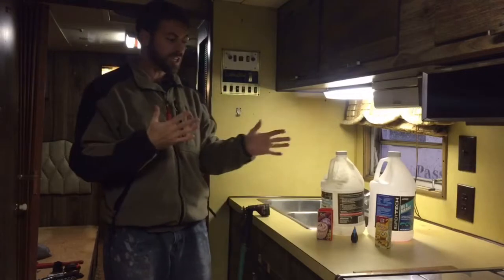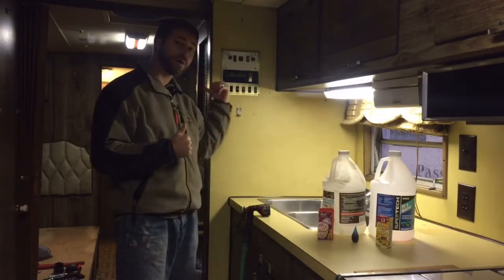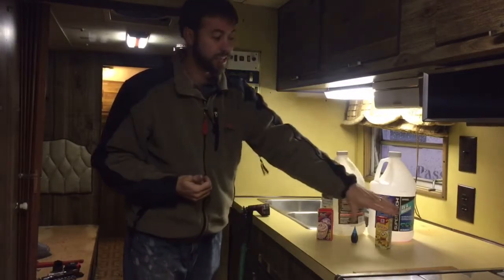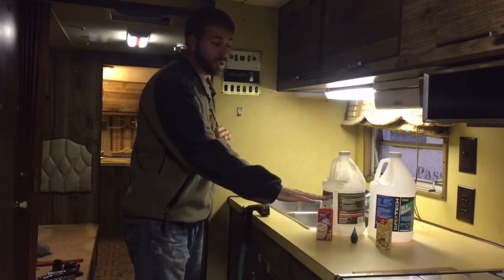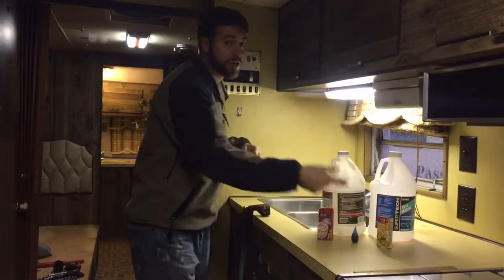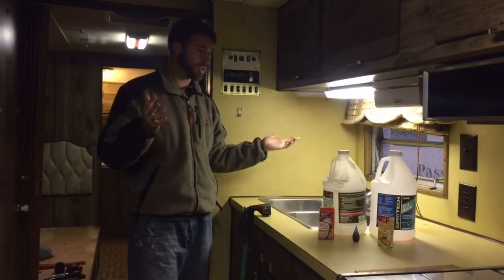It is my suspicion that the yellow and the blue from the sink up here in the kitchen and from the sink in the shower in the bathroom are actually going into one gray tank. So if the water comes out when I open the gray tank, and it's green, I know those two mixed. I also think the black tank of the toilet is by itself, so I anticipate putting red in and only getting red out. But let's say we get a purple out, or an orange, or even worse, some kind of blackish, brownish with all of them. We'll see what happens.